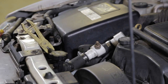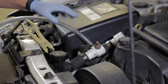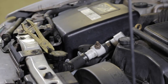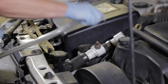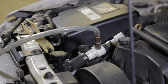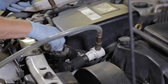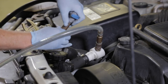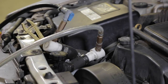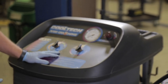Next up we're going to connect our two hoses. Remember the coolant coming out of the car is coming out of the radiator because we're pushing the coolant in a backwards flow. So I would connect the clear waste hose to the radiator, and then the black fresh recovery hose I would connect to the upper hose connection going into the vehicle. Once I've got it connected, I can open it. Now we're going to go to the machine and set the controls for the coolant recovery process.